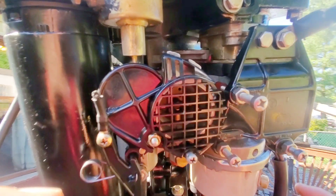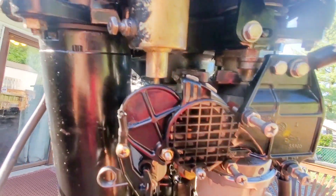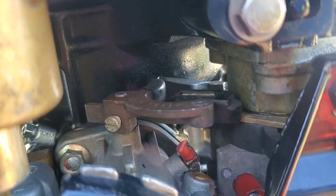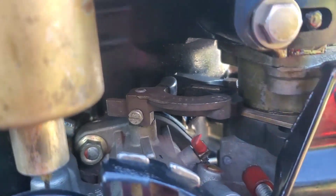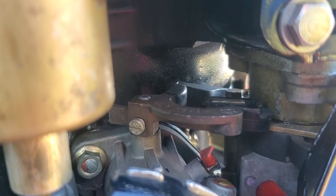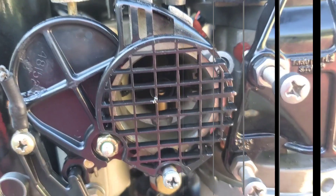Once the secondary hits, you want to adjust the throttle stop screw to where all the carbs are completely open. That lever right here has a little curve in it to slow down the butterflies from opening. You want that curve to actually hit the front and start curving before the secondary pulls all the carbs completely open.